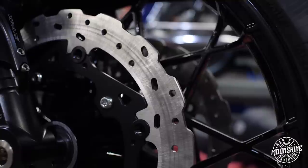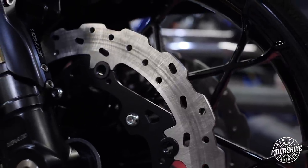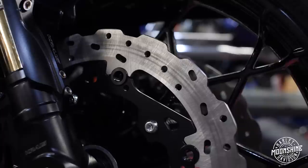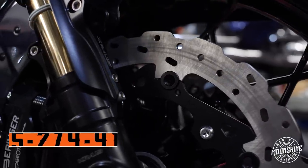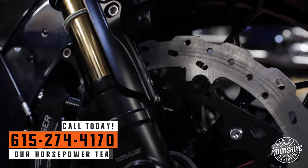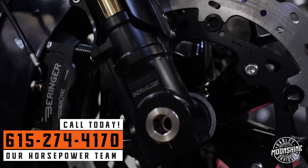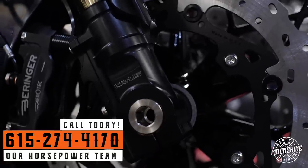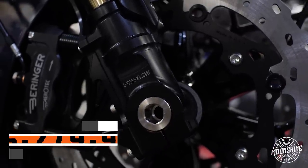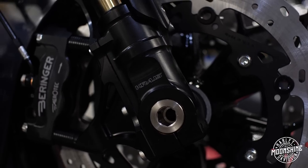We get a lot of comments from customers just on rotors. If you put a nice rotor on your bike at stock size the benefits are it's stronger, it won't wear as fast — but you really don't get extra stopping power until you move to better pads and a better caliper, possibly with an oversized rotor. That's when you really start to see the difference in front or rear braking.